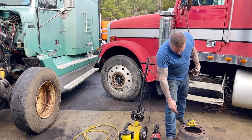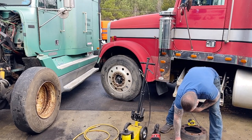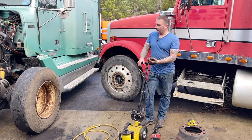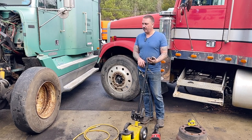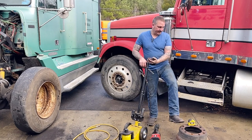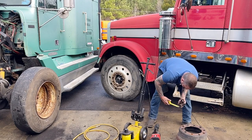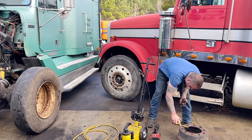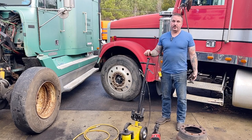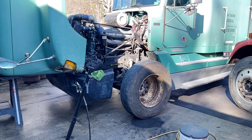This drum says max diameter 15.120. So there's 120 thousandths that you can turn those drums or wear those drums out before they're gone. So it's a 15 by 4 brake. It's 4-inch offset from the hub. It's an 8¾-inch pilot. These are 1¼-inch bolt holes. And so with that information, I came up with Gunite 3800X. So we're gonna hope for the best, see if we get some shoes, and let's get these brakes done. And we'll see ya.